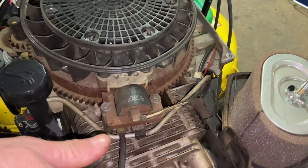There's a keyway in here that times against the crankshaft, and if this is sheared, that's exactly why it's backfiring and not running correctly. That is a 13 millimeter. If nobody has touched this and my thought is correct — if this is loose from the factory — let's see. I'm going to use the air gun. Oh, look at that — it wasn't even tight. That was hand tight. I have not been into this yet and this bolt was just hand tight. This is the problem — I don't know how it loosened up, but it did, and I'm thinking this may be sheared.